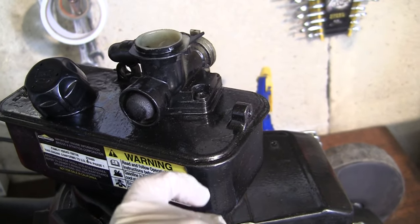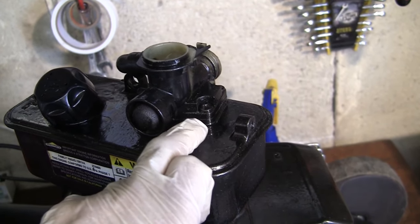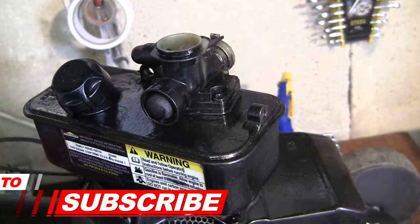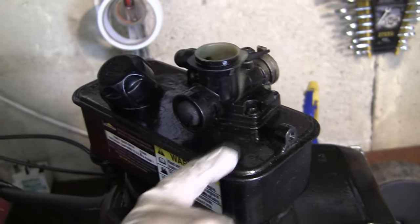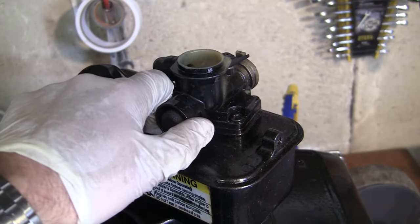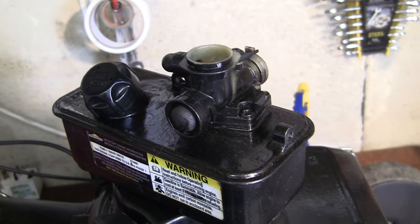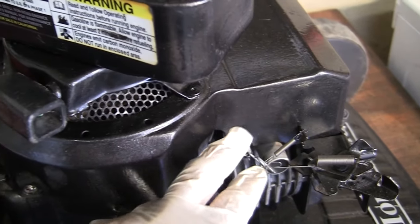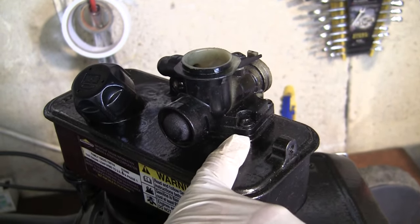So if you find yourself running around your garden trying to get your grass cut before your actual lawnmower packs in, take a look at the top right hand corner of your screen — I'm going to link you to a really detailed video showing you how to replace this diaphragm and gasket. These gaskets are actually available at my website, which is repairlawnmowersforprofit.com. Don't buy aftermarket parts, don't go on eBay for these parts. They're about £2 to £3 at the most. It's not worth spending £300 or £400 on a new lawnmower when you can take five minutes to change this gasket. That video will come up at the end of this video as well and in the video description. If you're messing about with the governor springs to try and stop your lawnmower revving up and down, you simply won't do it — you must replace this diaphragm and gasket in this carburetor.